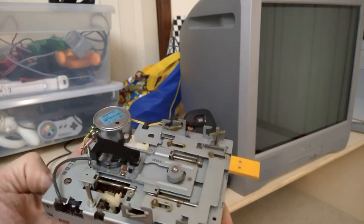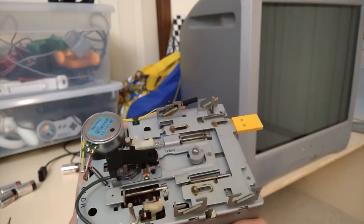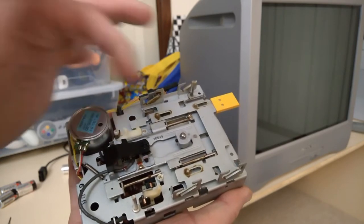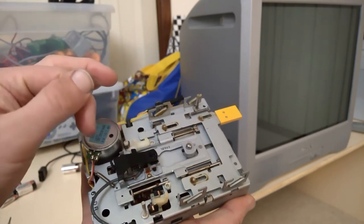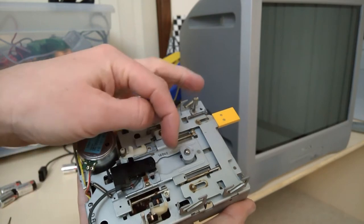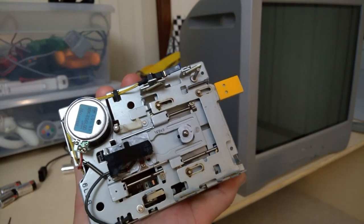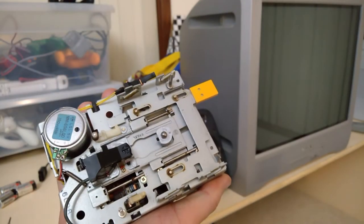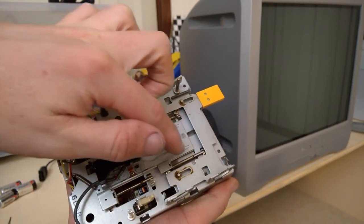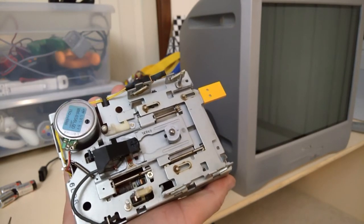What I've just done was take off the disc tray, and it gets you to wind the gear system back to when it goes all the way back to the starting position. This flat face with the screw is supposed to be parallel with this — in the process of changing the belt it can get misaligned. This was turned 90 degrees around here facing the wrong way. So hopefully now I'll put it back together and it will work.